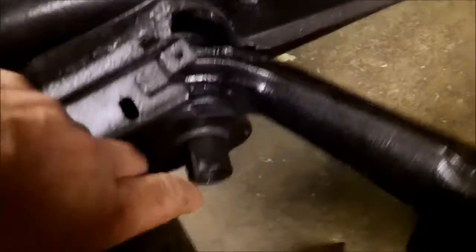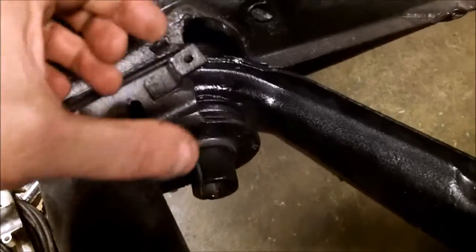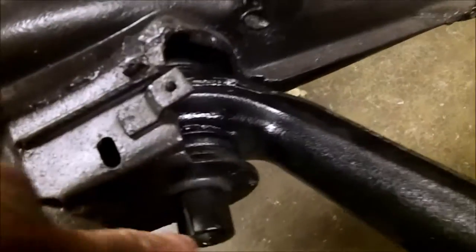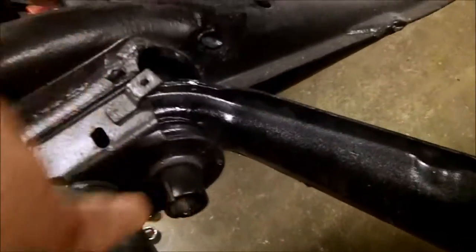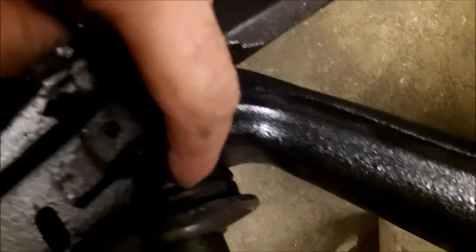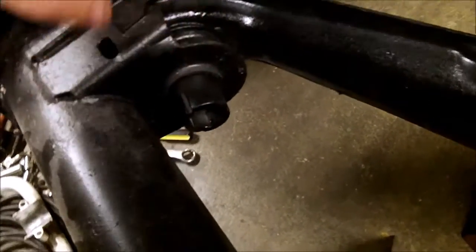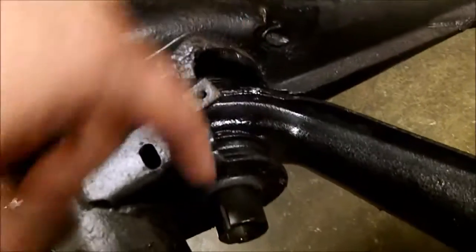Now this was always a thing I didn't know about. Got this big Allen bolt, and it has a shoulder that's about that long, and it's only got threads that are about an inch long. What it does is it goes right in this hole, and it's pushing on two washers, and these two washers squeeze the two rubbers that hold it to the inside, while the outside of the bolt is what fits to the OD of this. So it uses the inside bolt, but the outside bolt helps guide it in the outside hole there.